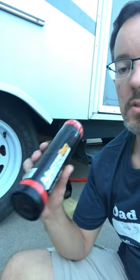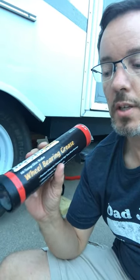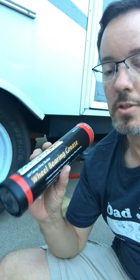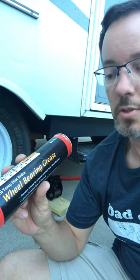And of course you're gonna want a tube of wheel bearing grease such as this. You can find these at your local hardware store. Make sure it's a high temperature wheel grease — not just any grease, but high temperature wheel grease for this type of job. A 14 ounce canister is what you want, which slips right inside the pistol grip grease gun.